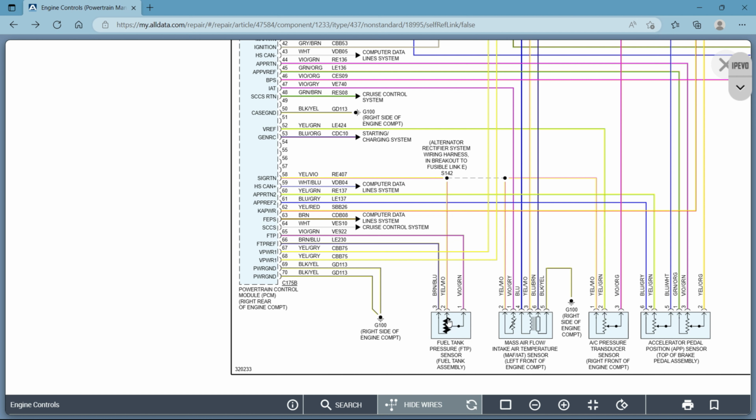That means that line will work its way back and forth on a resistor to change the values of your pressures in all of these. Okay, so they share a ground. Now, what you can see is, if you know that this is a ground, because that's what a signal return is. Signal return is another word for ground.